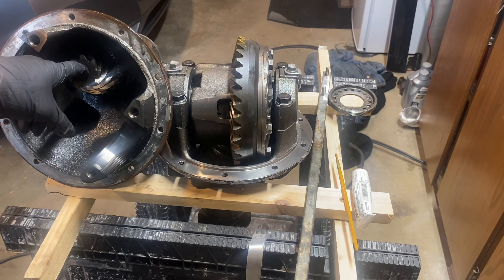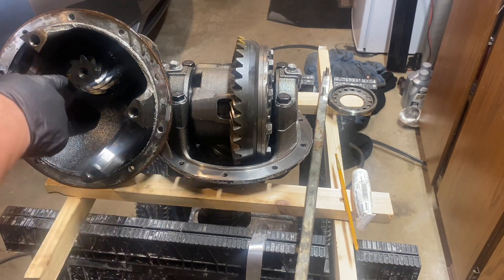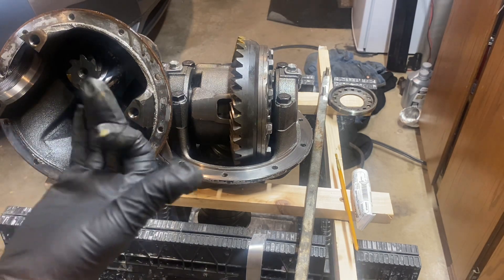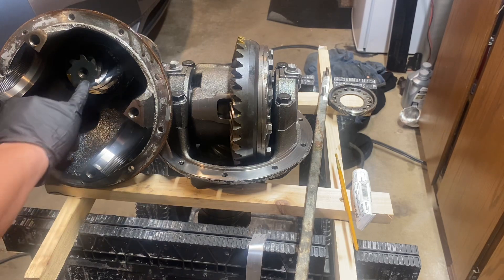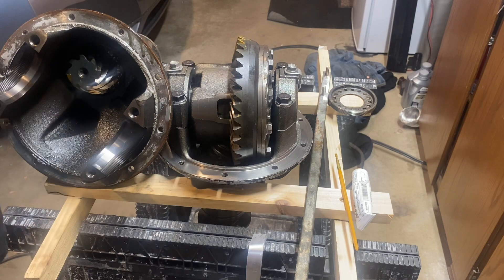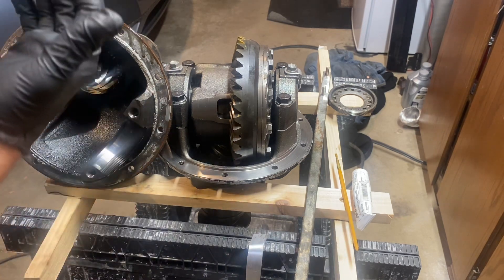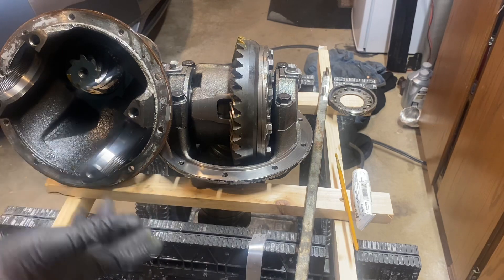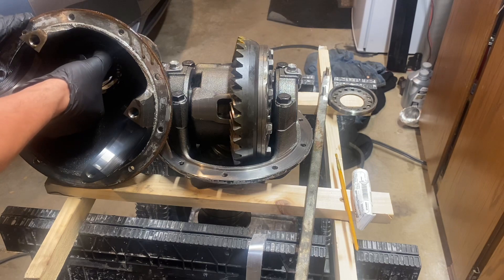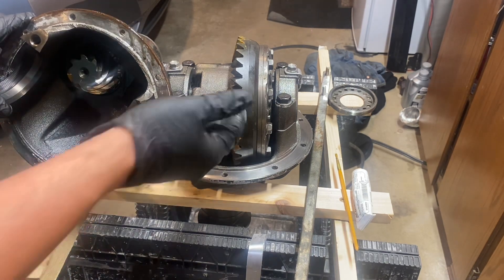It's really annoying because Mitsubishi actually has a special tool that sits in here used for setting the pinion height, unlike every other manufacturer which gives you a measurable distance from the top of the gear to the center line of the bore, making it a little harder. But since these are from the factory, we don't need to worry about that. It's always good to check if yours is tight — this one's tight, with 100,000 miles on it, and this new one is presumably tight too.